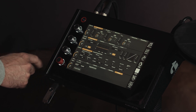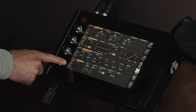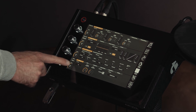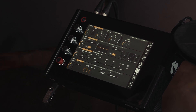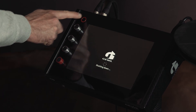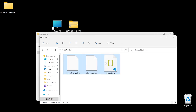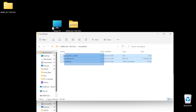Then go to the device tab and make sure that Auto Power Off is set to Off. This is important for installing the sound bank file because this will take a while. Now delete all files from your USB stick and copy the files from the sound bank download folder to the root directory of your USB stick.